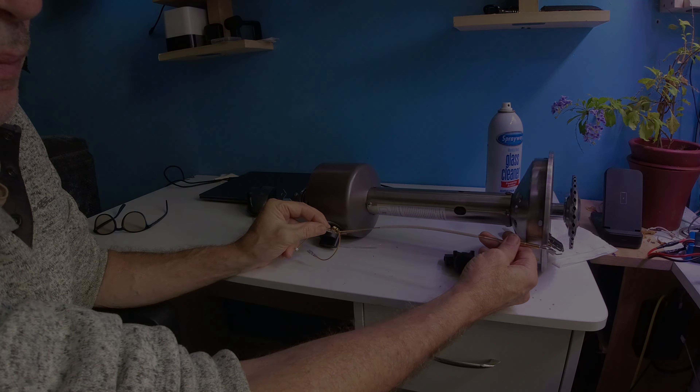You're going to need this kit if for many years these units don't work because they don't light up or what not. This is a kit you're going to want to get to replace your patio heater. If you listen to it, that is quite normal — it is going to tilt over and shut off by the weight that's inside. This is the thermocouple, these are the two connectors, and this is the sensor that goes into the bottom of the unit.